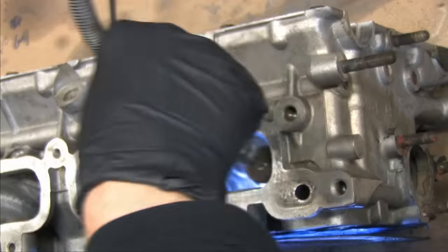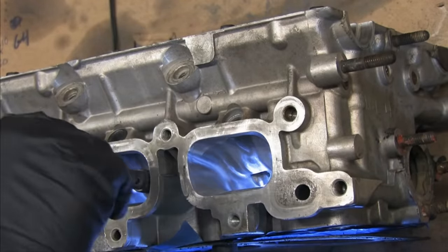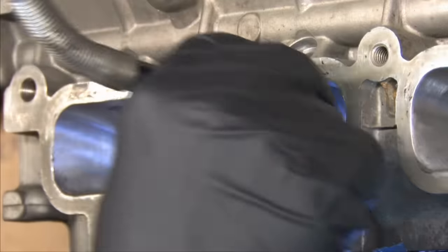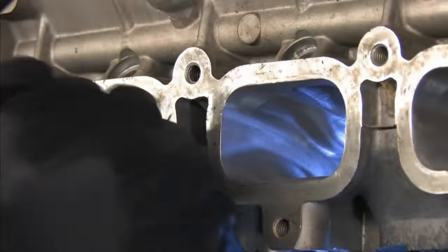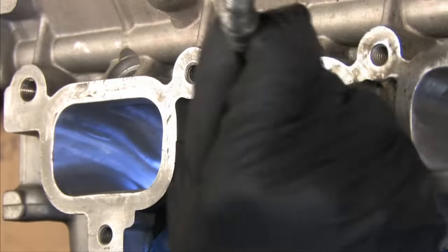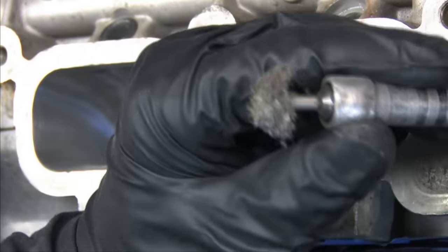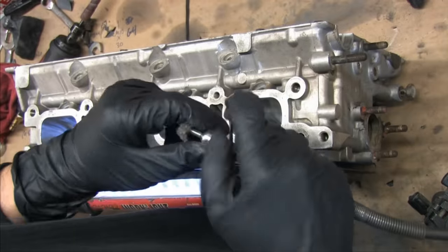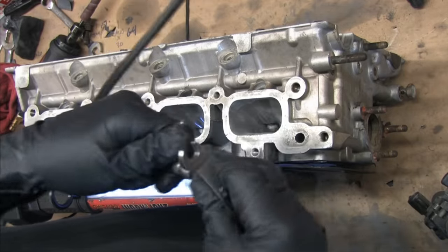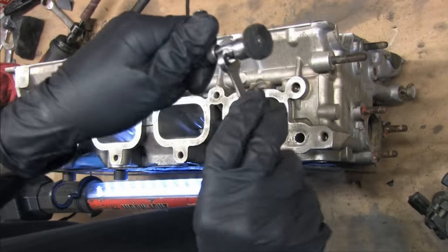Man, it's my lucky day. I don't need to listen to my air compressor for several hours. The tool I get to use now weighs 6 pounds less, and after 40 minutes of Dremeling to finish all four intake runners, the very first coarse finishing buff finally wears out. These things cost money, but I'm actually surprised at how tough they are. The finish they leave behind has the least amount of machine tracks of any abrasive power tool that I've ever used because these little discs are soft like a sponge. The 180 grit finish looks fantastic. Now we're going to step up to the 280 grit and keep going.